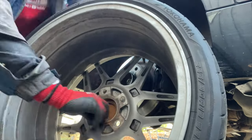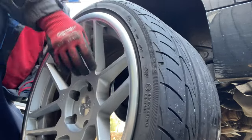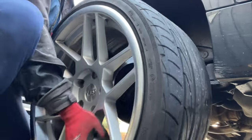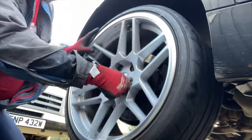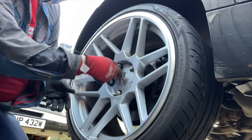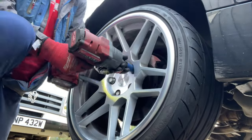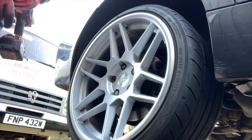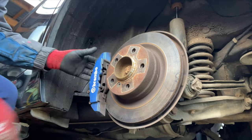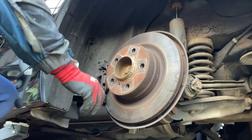I've got the wheel quick clean in the centre there around the spigot — just tackle that corrosion. Pop that back onto the car, get it lined up, drop it on. We'll drop the locking wheel nut in first and then put the other bolts through. I've set the torque on the gun — these are up to 120 Nm. Now I know you've all been laughing at my brake covers — they've just decided they're coming loose on the back, so I'll pull them off.